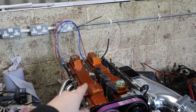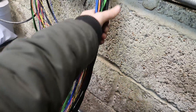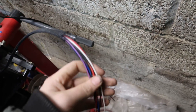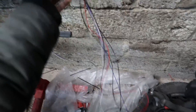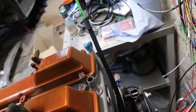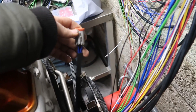I've got quite a lot done since the previous clips. Pretty much everything is wired now. I've got grounds for the sensors, a stub for IAT and fan control that I'll add later, TPS is all wired in, and a group of wires for chassis items including vehicle speed sensor, tachometer, tachometer ground, switched 12 volt, and main 12 volt. The alternator output also goes to the chassis. The wideband cables have a little bit left to finish.